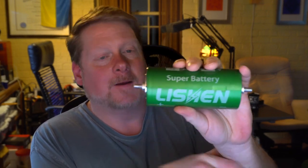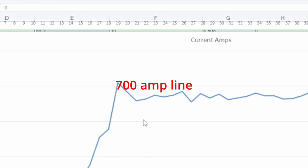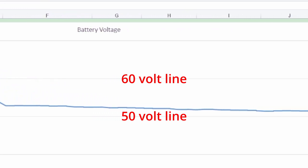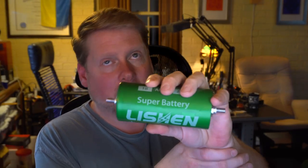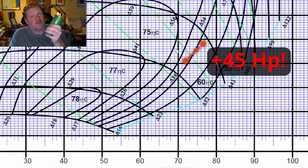These are the cells I'm running — 26 in series, and each one is carrying 700 amps, which is pretty amazing. I have more than enough to do a second set in parallel, which means the seven-volt battery voltage drop would get cut in half to about three and a half volts. We're currently seeing about 615 kV — 615 RPM per volt — and that would be another roughly 2,000 RPM. Looking at the compressor map, another 2,000 RPM is definitely significant, so this may actually be worth doing.